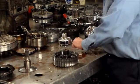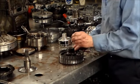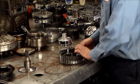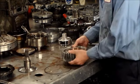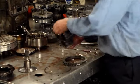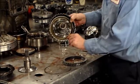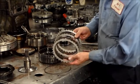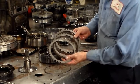Okay. On the shift kit, this also gets changed, this snap ring. They give you one in the kit, a different one. There's a molded piston here. That's what gets changed, that comes in the Raybestos kit, and these right here, these are usually always good, which they are.